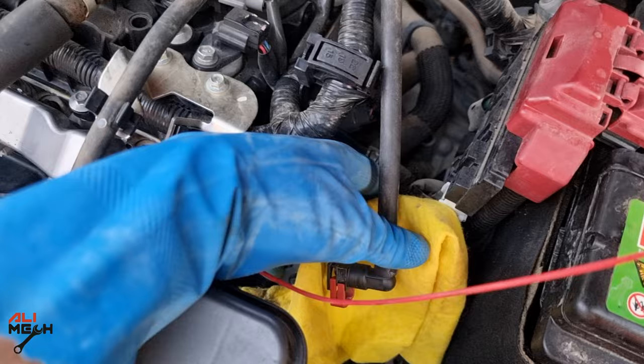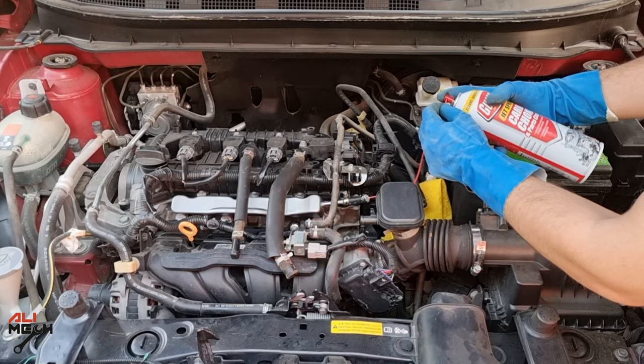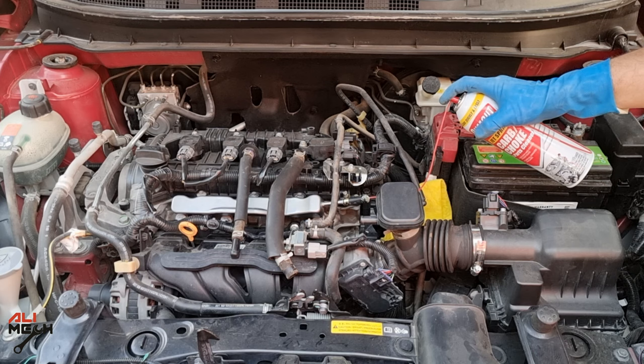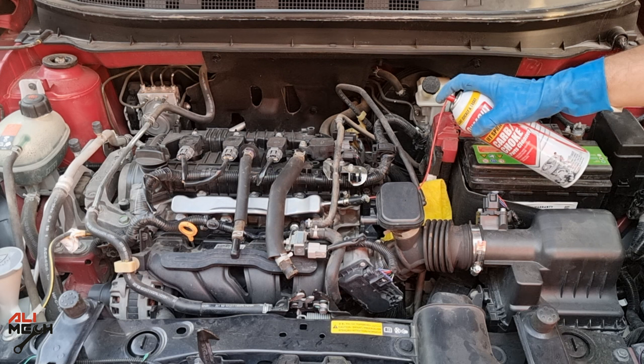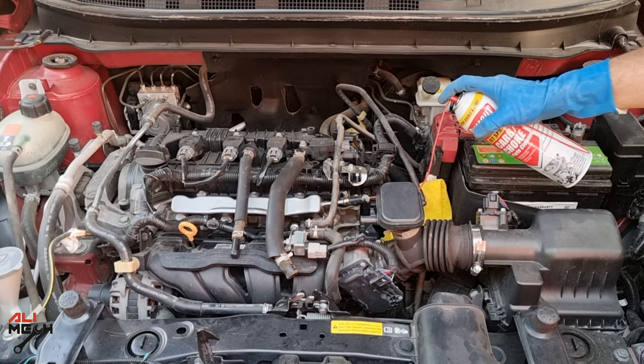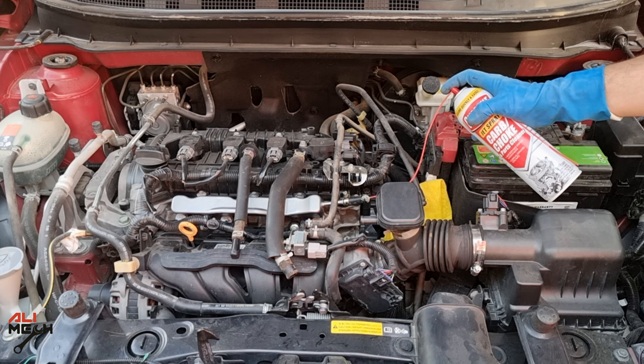Here is the DIY adapter on the fuel rail and here is the fuel line — we're gonna tuck it aside. Next, insert the straw into the carb cleaner nozzle and start spraying until it builds up a good amount of pressure, then start up the engine. Make sure to push the nozzle on the carb cleaner can so it feeds and keeps the pressure. The fuel pump wire harness is disconnected and the engine is still running. I keep my finger on the carb cleaner nozzle until the can can't provide enough pressure to run the engine smoothly, then I stop the engine.